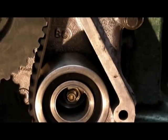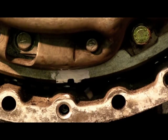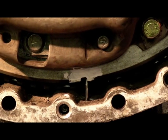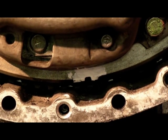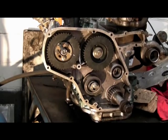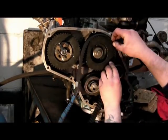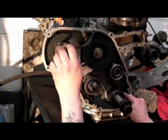This side of the belt is important first of all. The reason for it — as you can see on the flywheel side — it's half a tooth out, which actually looks miles out. So the importance of having a timing pin, or at least making sure that this groove is in the centre of the drain plug hole on your flywheel housing. Getting my timing back in — timing pin back in, that's right. Crank is now set.